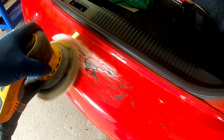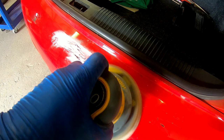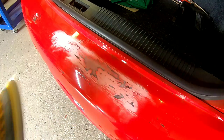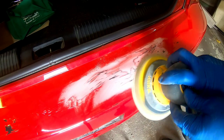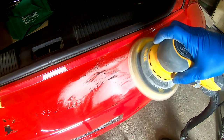What we have here is a repair that we see a lot of. It had a light impact on the rear bumper and it's cracked and started peeling the paint. This bumper has been painted several different times, so it has a thick edge of paint. We want to feather edge this out so we have a smooth transition from the repair area into the rest of the bumper.